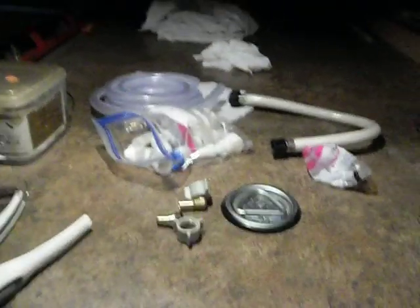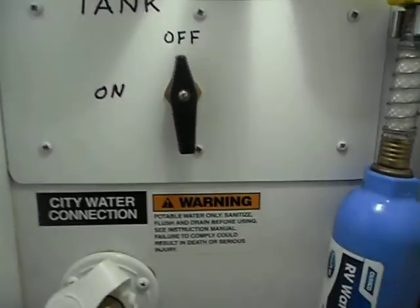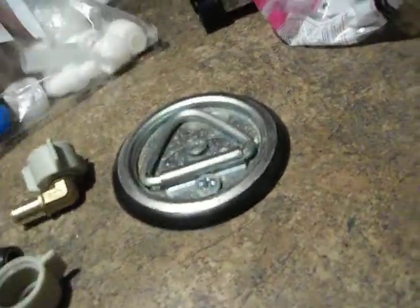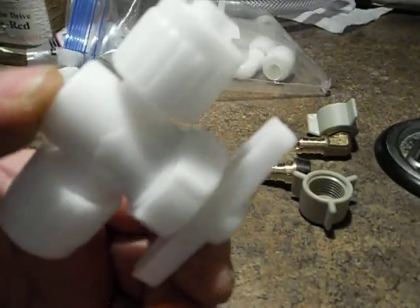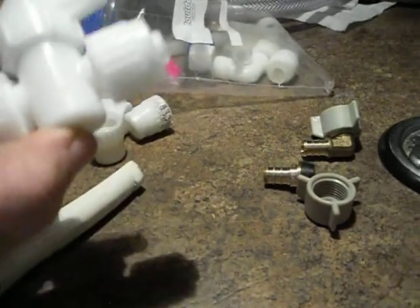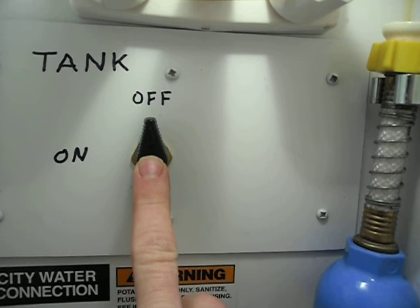Here's another RV how-to video. The first thing I did — these valves are junk right here. The little plastic valves like this one: it's plastic on the inside, got a little spring to hold it taut and a rubber insert. Don't trust them. So I went from this to this and just put a brass valve in here.